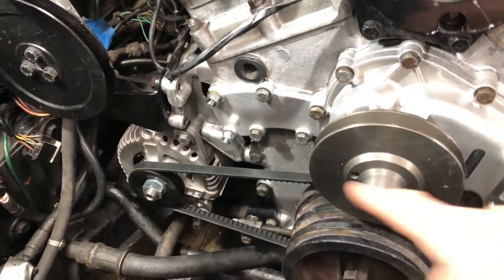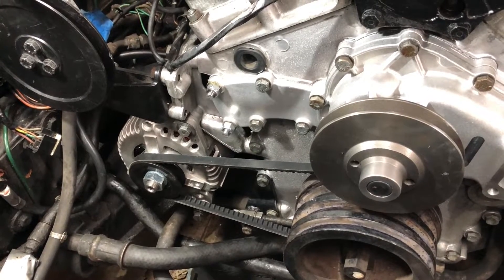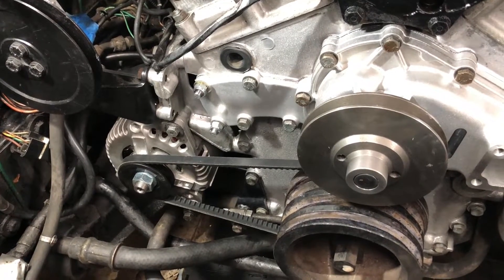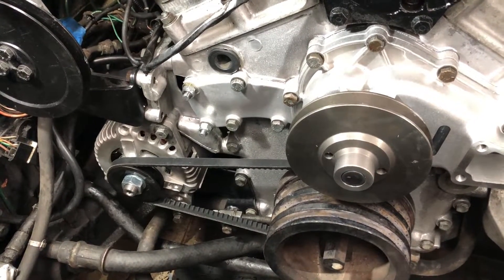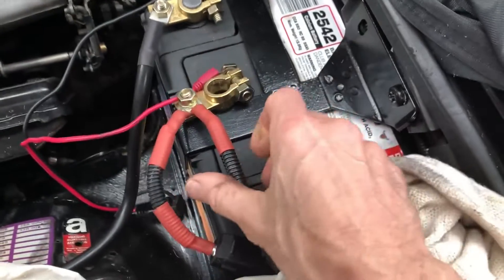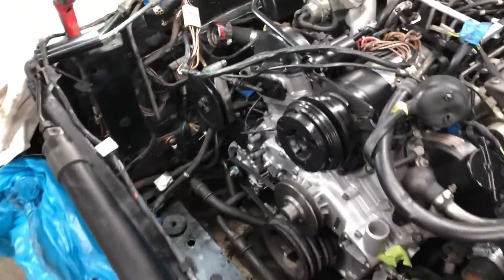The new alternator is in since the last video. It's a JCB item — as in a JCB digger. I couldn't find an uprated version for the Jag V12 even though Kirby Palm in his book had recommended multiple suppliers and models. That was the equivalent I could find that would actually fit. It's 120 amp output, which meant I had to upgrade lots of the cables as well, including a whole new positive fusible link. That's all installed and I've tested the continuity — that works.